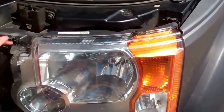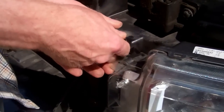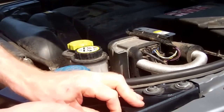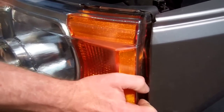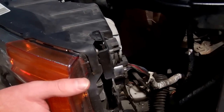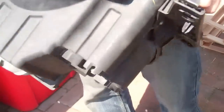Then we've got to pull the headlights out. You've got these little half-moon shapes here — these pull up. You'll see they've got like a keyhole section, and you just line that up. Tom's loosened these already, so we'll pull that one up — they might be a bit stiffer on your car. If you look in here, you can see as that lines up it locks those in. Then just push down on the top connector there, pull the light away. So that's your headlight out and your grille out. I know this is looking a bit scary now, but it's not too bad.